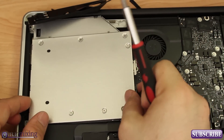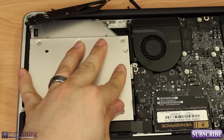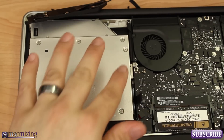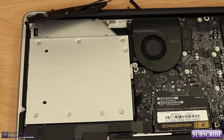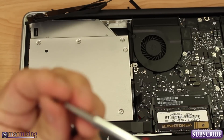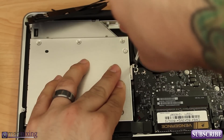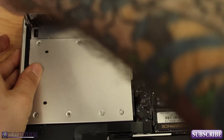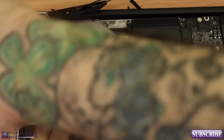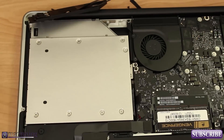We can go ahead and slide this right back into where we found it. Be careful and have patience with this stuff. It looks like we have a nice fit — everything seems to be in place. Now we can start piecing this back together. We're going to put the three Torx screws back in that hold the caddy down. There shouldn't be any wiggling between the caddy and the MacBook — you should have a really nice snug fit, just like that.